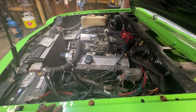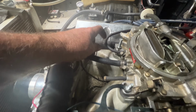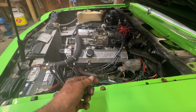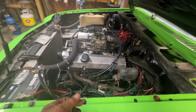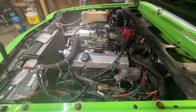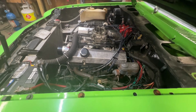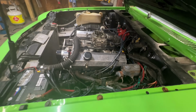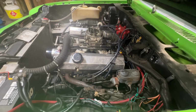And I had to put it back in with a little piece of vacuum hose like this right here. I had to put that on the end of the plug so I could twist the hose to get the spark plug started in the hole. And I tightened it up as long as I could until it wouldn't tighten no more with that hose. Pulled the hose off and then worked the rest of the way with the 3 wrenches. So it was a booger. I hate it. I don't think Shanks ever changed the plugs in this thing. I don't think they've ever been changed since I had it. So maybe it'll run pretty good now.